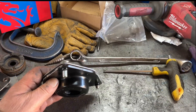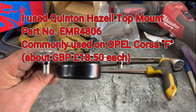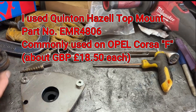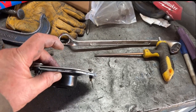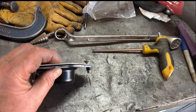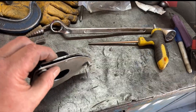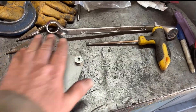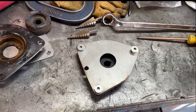There's one of the new top mounts. You'll notice there's a gap there — the rubber bit sticks up above the surface slightly. So what I'm going to do is tighten down these bolts, compress it, and tack weld the plate at the top in a few places so it sits as low as possible, putting a bit of compression on that rubber. And that should work.